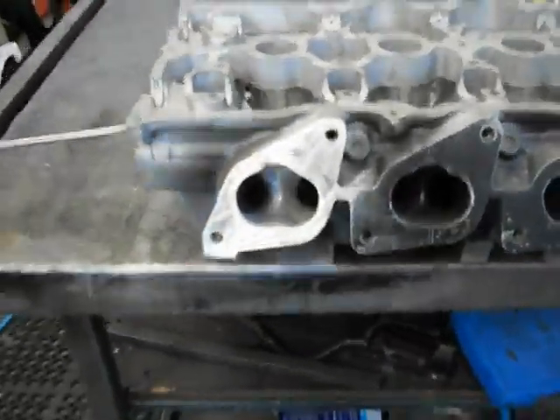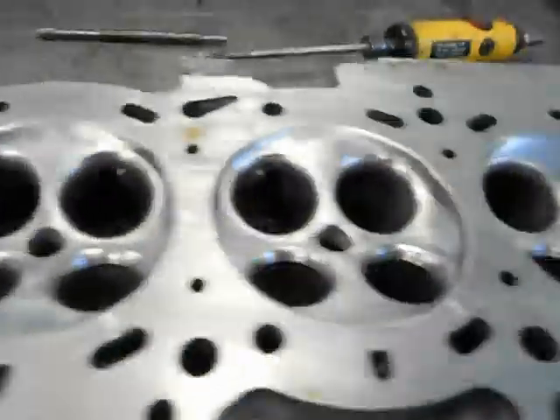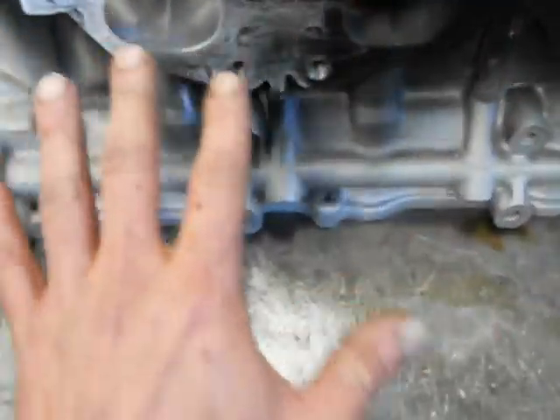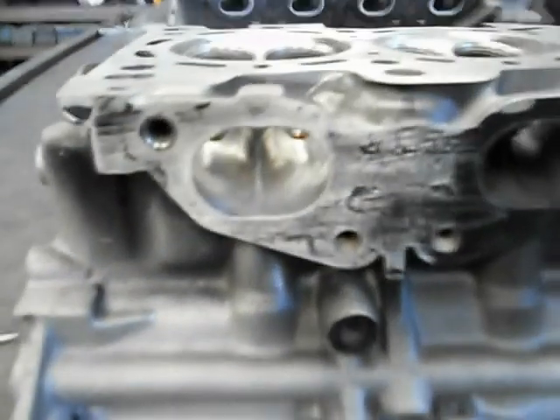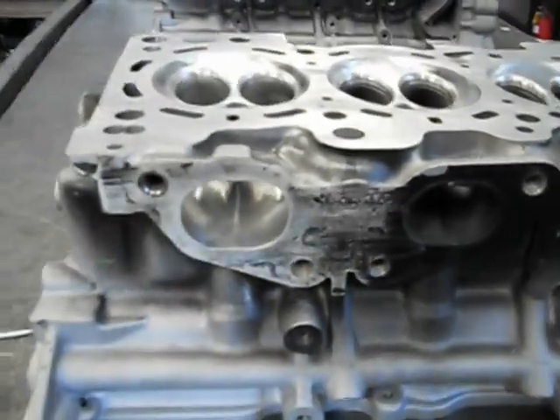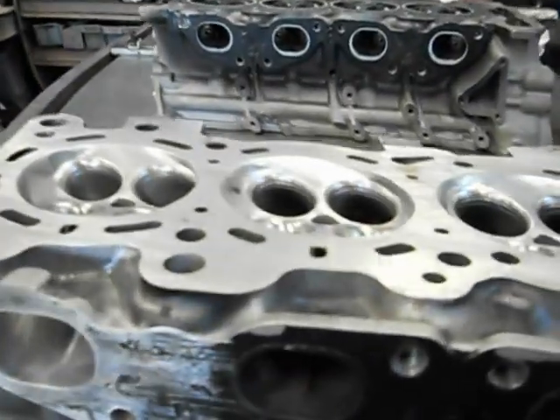When you port you're better off doing everything in sequence. Go through and do all your chambers, then go through and do all your exhausts — the bottom of your ports — so you're just in that groove. It's a lot better doing it that way because you're going to be a lot more even from port to port as you're just doing each little bit at a time.